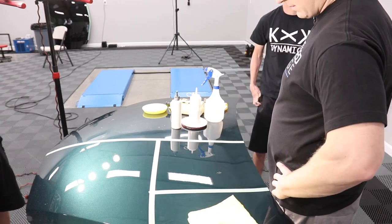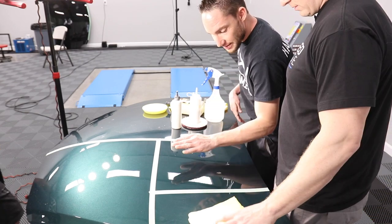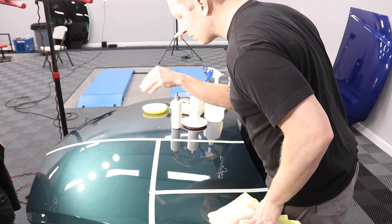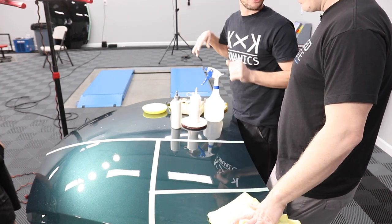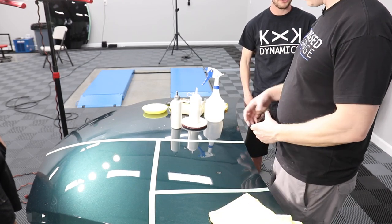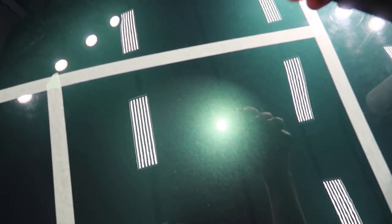Do we know why that is? Did I remove more oxidation by doing that? No. What we did is we flattened out the clear. By flattening out the clear, as the sun beams hit and refract, this area that's sanded smooth has more even refraction. So even though I didn't remove the peel, I've cut the top of it off. Correct. So we're adding more reflectivity, which is changing the look of the color. It's not changing the color, you're going to have a deeper, richer color.